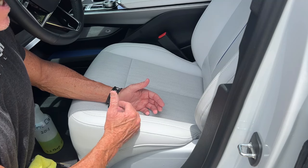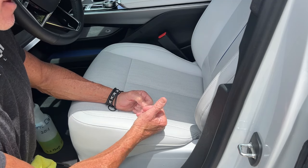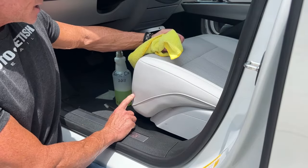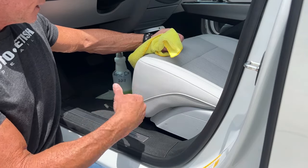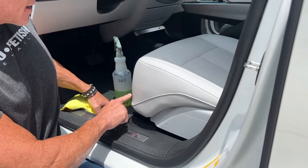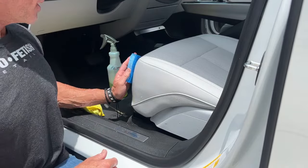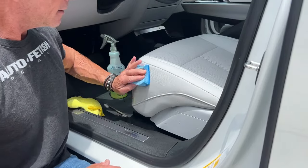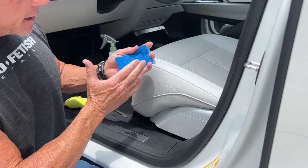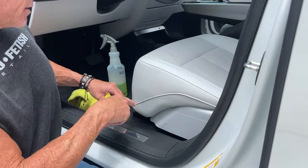That's code for: we're not using leather to construct the entire seat. This section of the seat, especially the driver's seat, is notorious for getting skid marks from people's feet as they slide in and out — they grab the heel of their foot right against here and make some skid marks. This one is not extensive at all; I probably won't even have to do anything special. I grab the scrub pad. One thing I love about scrub pads is that they conform perfectly to your hand and the surface contours.